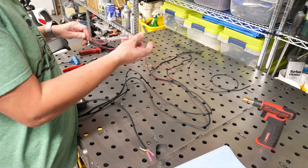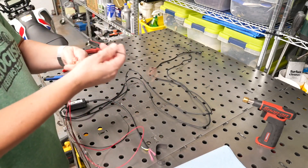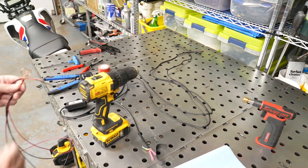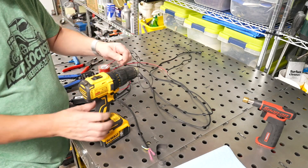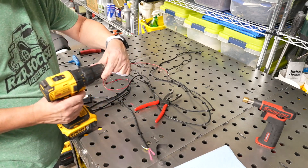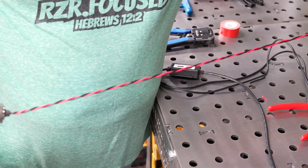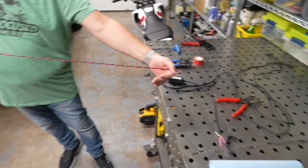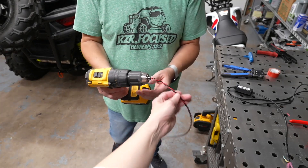On our test lead we did a little battery connection — a black and a red for positive and negative. I'm going to make a quick little wiring harness. I don't want wires just randomly loose, so I'm going to cut these the same size, put them in my drill, and twist them together. I'm just guiding it with my hand — and see that? That is so cool. Now we have a little wiring harness, all wound together and braided.